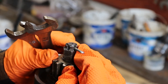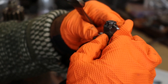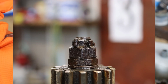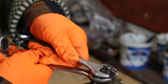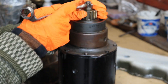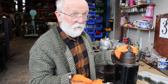The first thing we'll notice is that the pinion is free to move — this is really important. These nuts should not be tight on the pinion itself; there has to be movement there. The lock nut has to be moved down in order to let the top nut off. It can be quite tight, so slacken that off and make sure it's nice and slack. It goes without saying that you've sprayed penetrating oil on here, maybe left it for a few days.